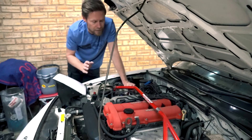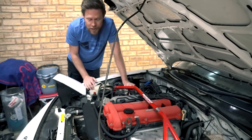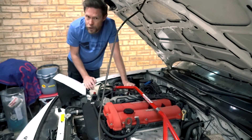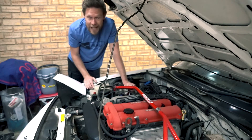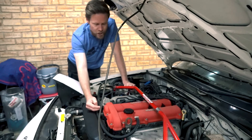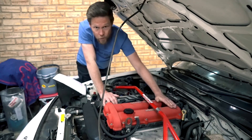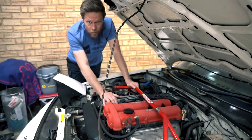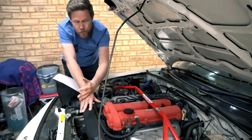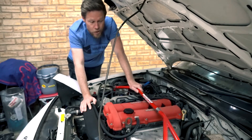Another reason I think the head gasket may be blown, aside from it losing water, is a common design flaw in these B-series Mazda engines, especially when used in a Mazda MX-5. They were never designed to run longitudinally from front to back — they were designed for front-wheel drive, to run transversely. As such, their water ports, inlets and outlets on the block, are both on the same side, so there isn't a cross flow of water. Water goes in at the front of the engine, circulates partially, then is ejected back into the radiator, giving you really poor flow towards cylinder number four against the firewall. You can rectify this with a coolant reroute that takes water from the radiator and plumbs it into the back of the engine. We've checked the plugs and they all seem to match, so there's no warning bells just yet.